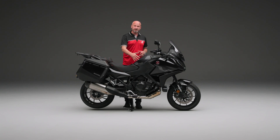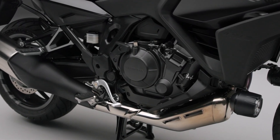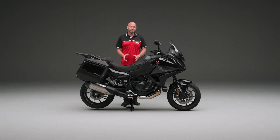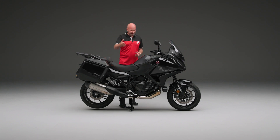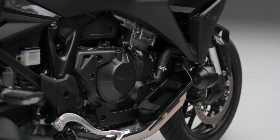That's because the motor — the power plant of this particular bike — is the 1084cc parallel twin that we've seen on things like the Africa Twin. Now it has been tuned differently for this bike, because we're going to want higher speeds and more progressive acceleration as well. This is going to give us 75 kilowatts of power at 7,500 revs.